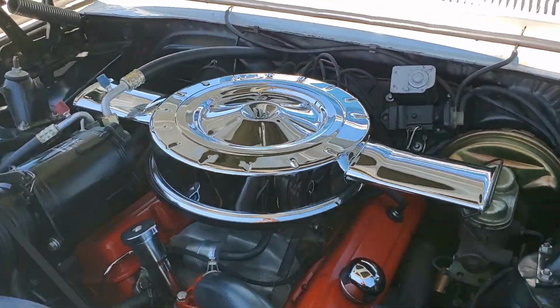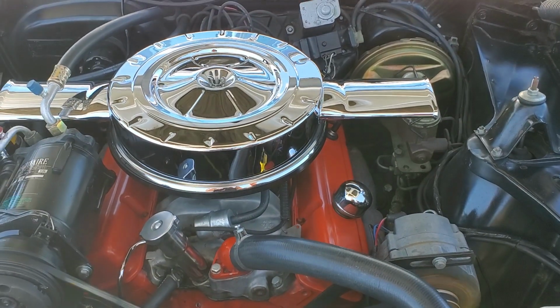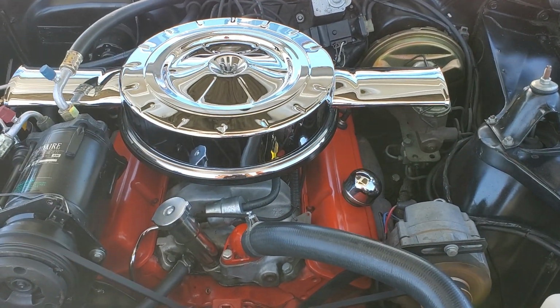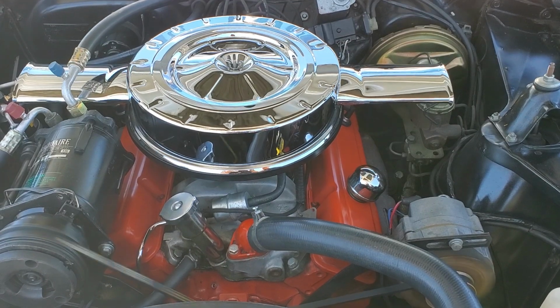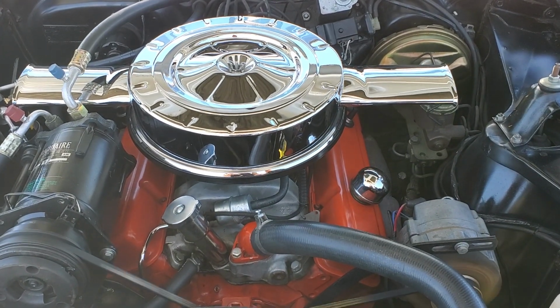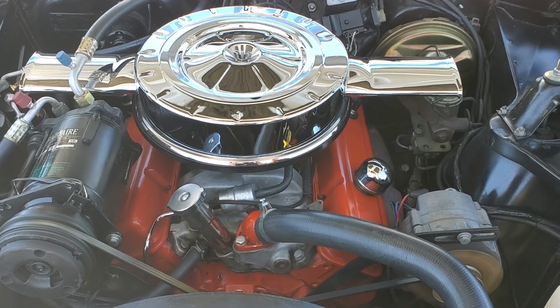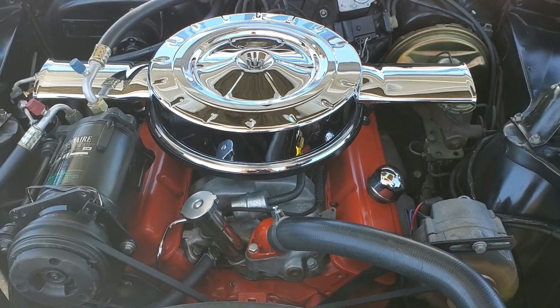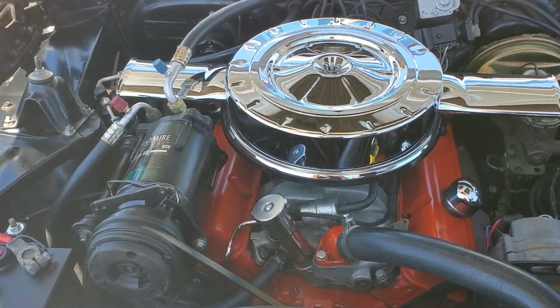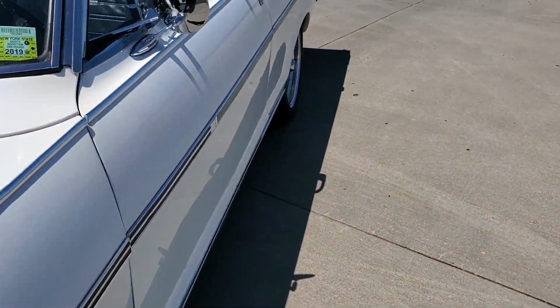So tell me about the engine build. The motor is completely built. It's a 9-to-1 motor, so it will take regular gasoline. There's a competition camshaft in it, competition valve job on the bottom end, screw-in studs, roll tip rockers, and what they call Rhodes lifters. Dual exhaust pipes, 2.5 inches to the rear of the car. Sounds good. It has a crossover pipe for increasing torque.